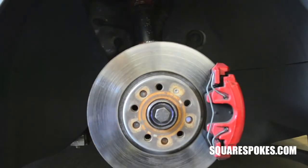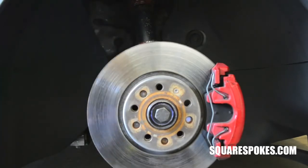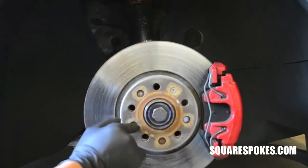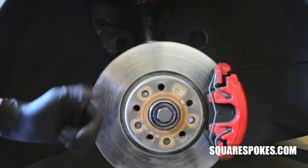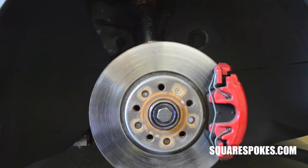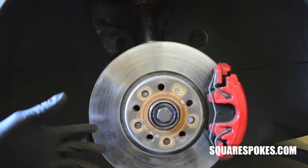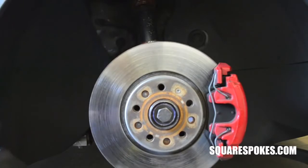Like I said, a lot of times they're custom made, so it can take a little bit of time and material for adapter companies to make the ones you need. You also need one for each wheel, so that's 4 per car. It definitely can get a little bit expensive. Also, due to the physical size of adapters, it actually adds weight to the rotating mass of the whole assembly, and it spaces your wheels out, which changes the final offset. The smallest adapter that I know of is at least 15 millimeters thick. So what that means is if you have a plus 35 wheel and you use a 15 millimeter adapter, it changes the final offset to plus 20.